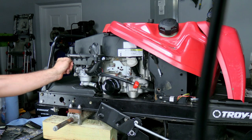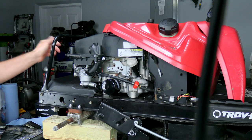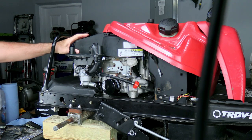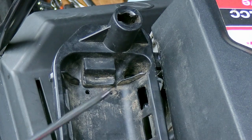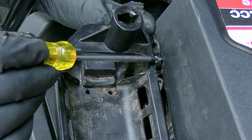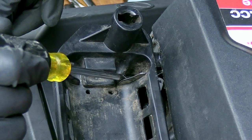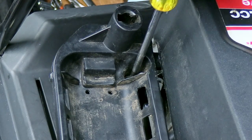Your airbox may have a screw tab that's underneath the cover for the top of the motor. Mine did, but I don't have to take all this apart. I can take the carburetor off without removing all this - you can get to every screw except this one. I don't know what genius engineer thought of that. That tab right here goes underneath, and that's why you can't get all this off because of that one tab. Yours might not have a bolt in it, but mine sure does. So there's a Phillips screw right here - just take this out, and that's all you really have to do up here.